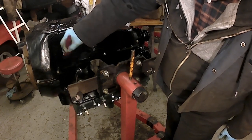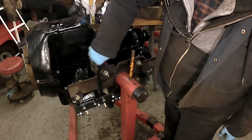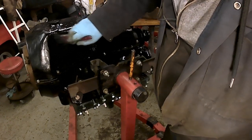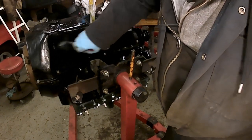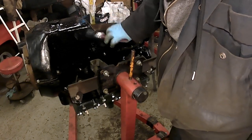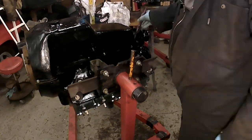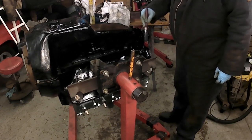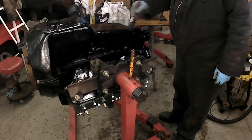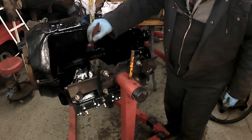These were a good find — these were on UK eBay. I bought three oil pans; they were all new old stock. My mate had one, there's one hanging up on the wall over there, and this is the third one. It's compatible with the British type oil pump, and maybe others. It isn't compatible with the American type starter — they'd have to modify the opening. It's got an egg-shaped opening with a smaller diameter hole, and it fits the Lucas Pilot type starter.